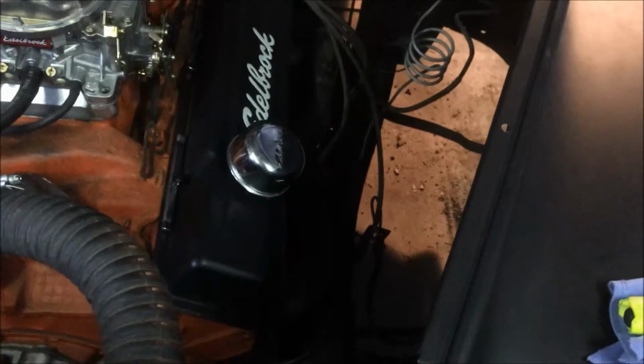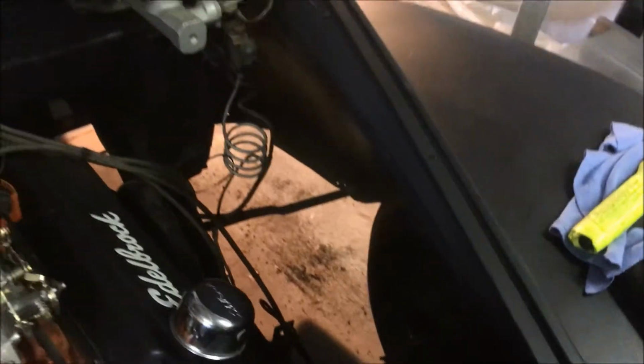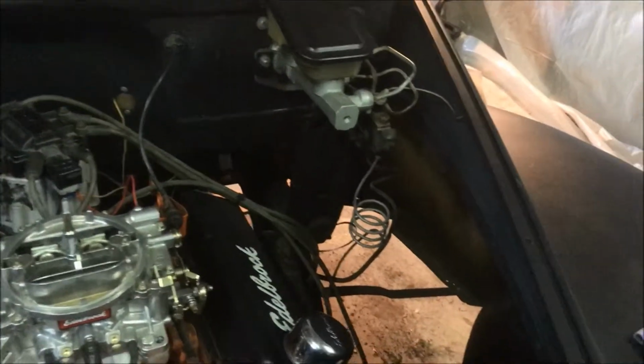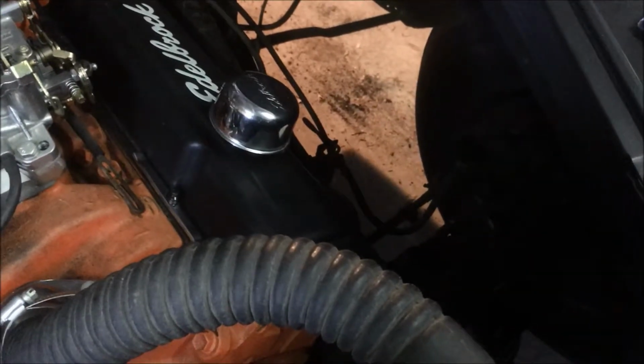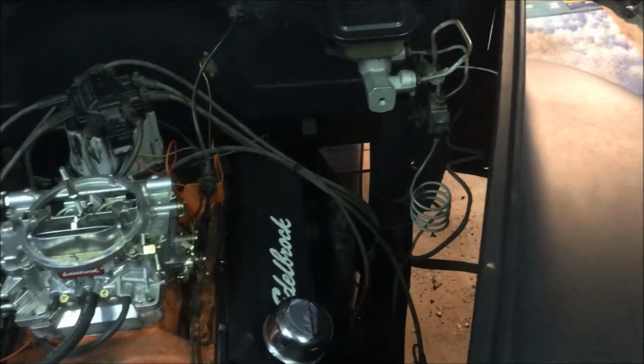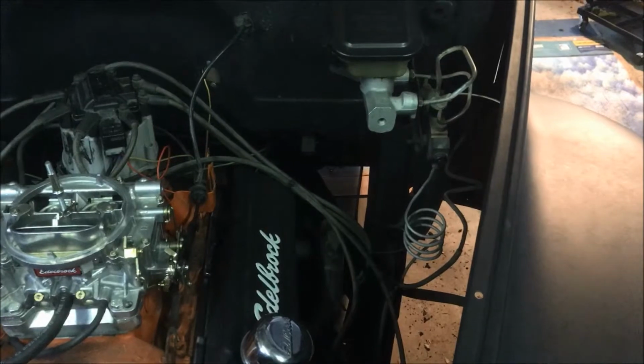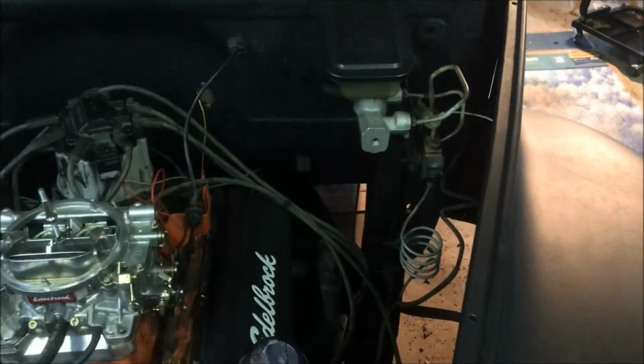If I could have got over here earlier, I was going to go ahead and take that steering box off and cut that. I may do that tomorrow if I can get over here for a little while. I'll jack this up, take the wheels off, because I got the other wheels to put on anyway, to see what it looks like with all 4 wheels the same. So I'll jack it up and take the wheels off and take that box off. Then, like I said, I want to take it to work and weld up that pitman arm, and then I'll bring it back. In the meantime, I may order the 2 U-joints and some double D shaft to make that steering shaft with. I still have to figure out how I'm going to hang the column on the inside.